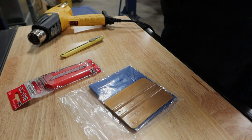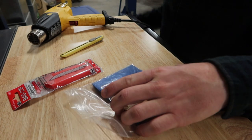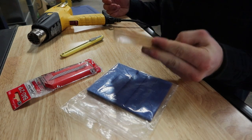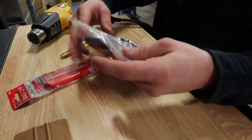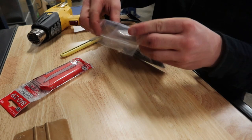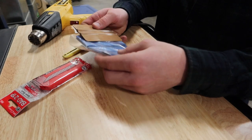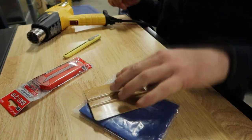To install a wrap on a sled, you really only need a few tools because most of the cutting is already done for you. The biggest thing you're going to want is a squeegee — a good squeegee. 3M makes what I think they call the Gold Series. You're going to want to pick up some monkey strips, or go to your local Joann Fabrics and get some felt strips. Basically all these do is go right on your squeegee so that you don't scratch up your wrap.